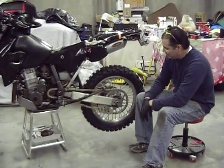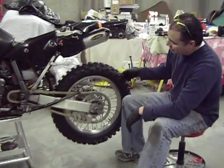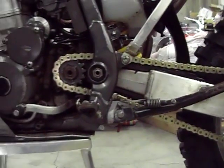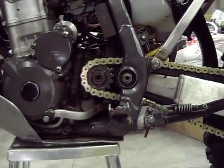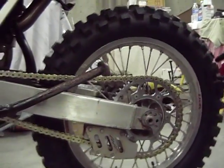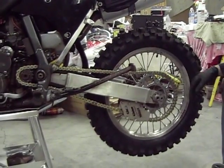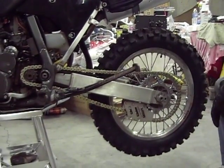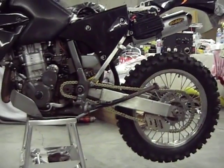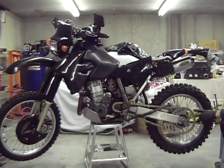Welcome back everybody. We've got the new 48-tooth sprocket on. We've also got his new bling factor gold O-ring chain. We've got the Renthal sprocket on the front, and we don't have the cover back on yet — we're going to put that on in just a minute. The chain was just barely long enough, and after it stretches a little bit it'll probably need to be adjusted again. But we've got just enough adjustment in there now for him to get started. Utah Backcountry Discovery Route approved.